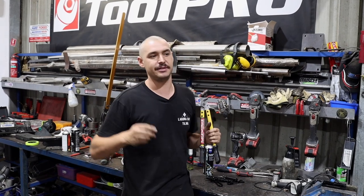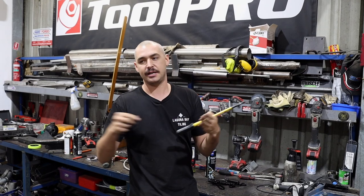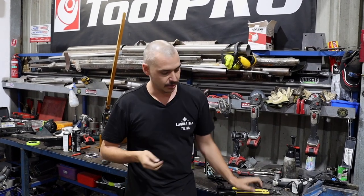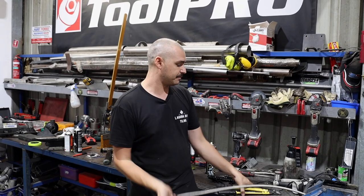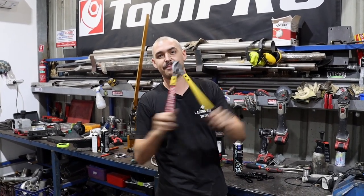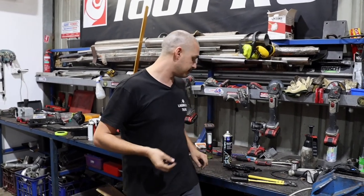But a quick recap is make a list, get your notepad out, write down the fittings you're going to need: 90s, straights, 45s, in whatever style hose you're going to use. We are using Teflon hose for this, which is single dash six line. Straight up, you're going to need yourself one of these finger decapitators, a parrot beak cutter. Otherwise, you won't be able to cut the hose. You can use a grinder for 100 series.